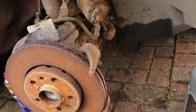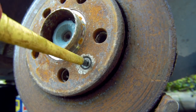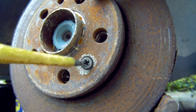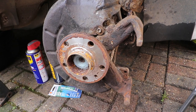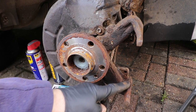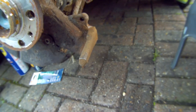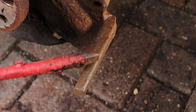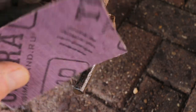To take the disc off, just unscrew the little grub screw. If it's been put in too tight, you'll have trouble — in which case you can knock it with a hammer as you turn it, or use an impact driver. They're only a locating screw, so there shouldn't be much torque on it at all. Take it out and the disc should come off. If it won't come off, it'll be because it's fused to the hub with corrosion, in which case just knock it off around the perimeter with a hammer. Once you've got the disc off, you can get access to the carrier. Clean up the guides both top and bottom — do most of it with a wire brush, knock all the loose rust off with an old screwdriver, scrape it off, and use some coarse emery paper to sand it off.